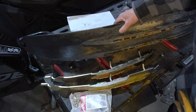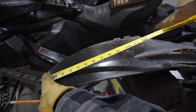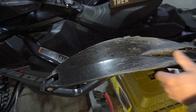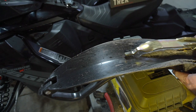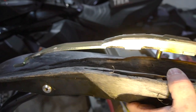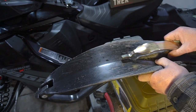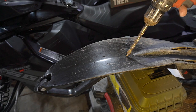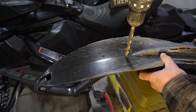What I want to do is take the drill and as I'm drilling, pull it back so that the hole has an angle to it. Measure from this part of the ski to 10 inches and double check it — that looks about perfect, it's going to line right up. I've propped the tip of the ski up so it's not as floppy. With our 7/16 drill bit, I pull it back so the hole gets a little angle to it and helps the tab come through.